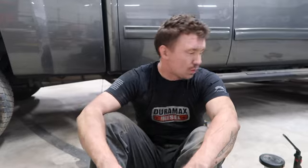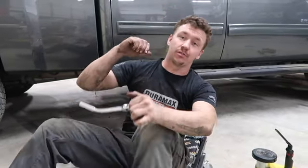As far as that goes, we took off the downpipe clamp. Definitely use PB Blaster and maybe a wire brush first, because I'm pretty sure I stripped mine out. Hopefully I have another one. I hope. Really hope. But I don't know. So it might be salvageable. We'll see. It got really hot though, and the threads look kind of all as one, and they're not supposed to. So yeah, I'm gonna go back under and finish getting these out.